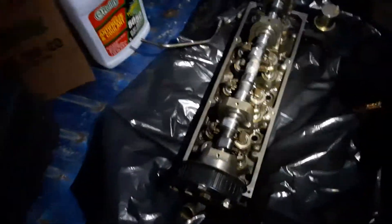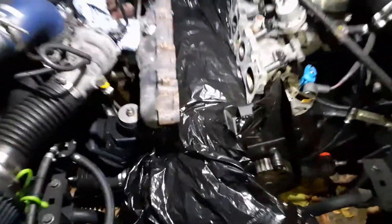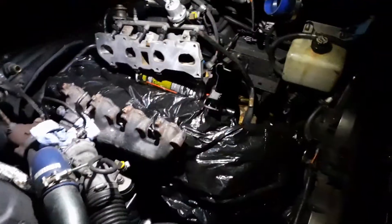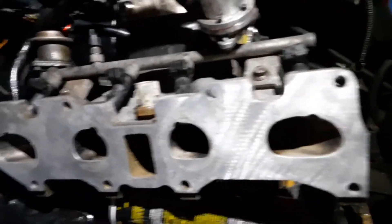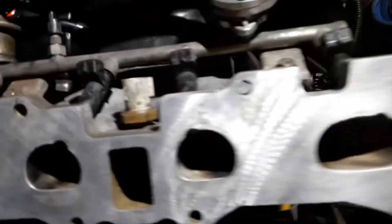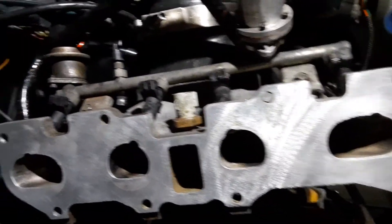Another quick update — I got the head cleared off, cleaned all the silicone. That gray stuff, I tell you, you put it across the back here, run it up here in this corner all the way out — it's no good. Got the block cleaned up. This is a ported intake and a ported manifold. I just did a light cookie with the 3M plastic wheel, wiped it down with scotch-brite and brake clean, and blew it out. About to do the manifold side right now.